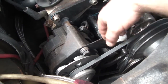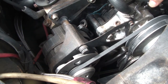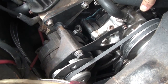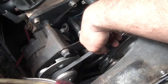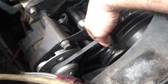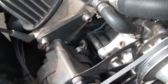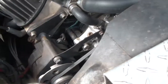There were a couple different issues I had to deal with. I already had a 3G alternator wired up, but the brackets weren't right — one was a 7-inch spacing, the other was 8.25-inch spacing between where they connect. A V-belt just is not powerful enough; it doesn't put enough tension on there to grip a 130-amp alternator. I tried before and it just doesn't work no matter what.